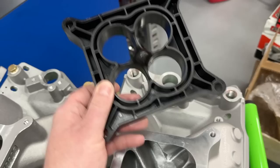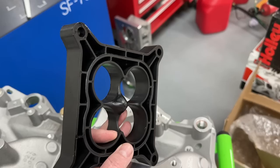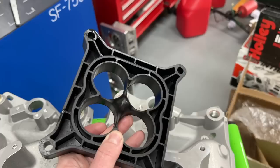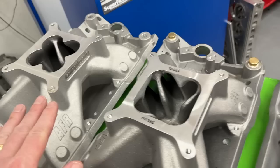All intakes were tested with this four-hole taper spacer from AFR. Of all the spacers I've ever used, this one's probably been the best for showing results - over doing a one-inch open spacer. AFR is not paying me to say this and they didn't even give me this spacer. They're around $50, phenomenally cheap, but it's the only spacer I've ever seen gain what this one does. It actually gained 10 horsepower over an open spacer - I've never seen that before. Usually you'd be lucky to get eight horsepower and you'd spend $200 on a spacer.